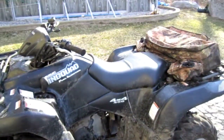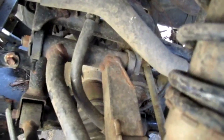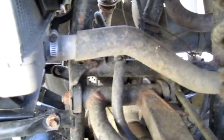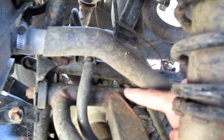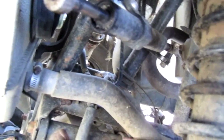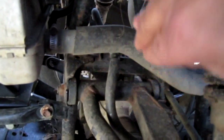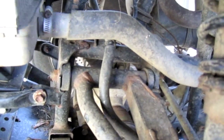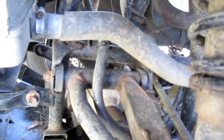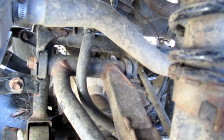2007 King Quad 450. We're going to be doing the Demijohn caster mod. The part we have to actually modify is down here on this upper A-arm — we're going to be removing some material on the back of this tube. Then we're putting a shim washer up in the front and shifting the whole tube back 0.187 of an inch, as called for in the spec. We're following the procedures we got from our good friends over at NYROC.